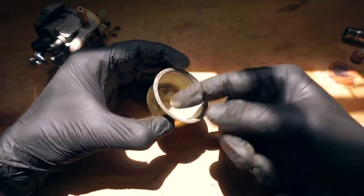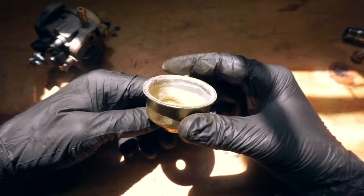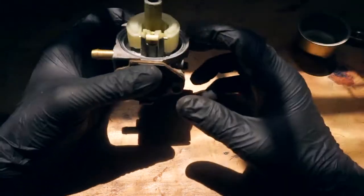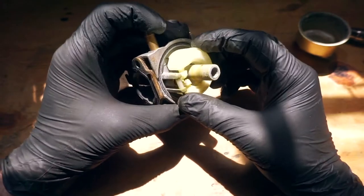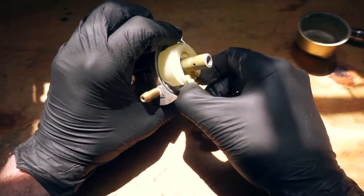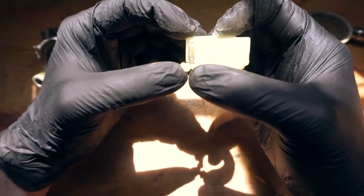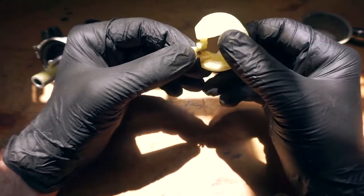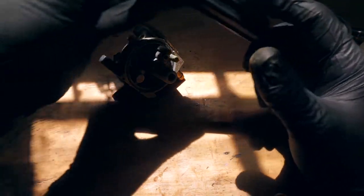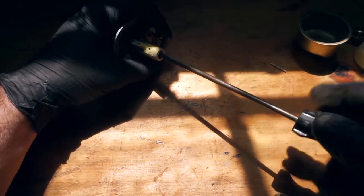As you can see, this is pretty bad — got a lot of what looks to be ethanol residue. Usually this happens when the lawnmower sits with ethanol fuel, which is basically plant-based and has a lot of water in it that separates out of the petroleum and causes all that corrosion. Hopefully the float works. Yeah, it's moving there, maybe a little stiff. I'll pull this pin out and take the float and the needle out. The needle actually looks pretty good. Sort of the float too, just dirty.